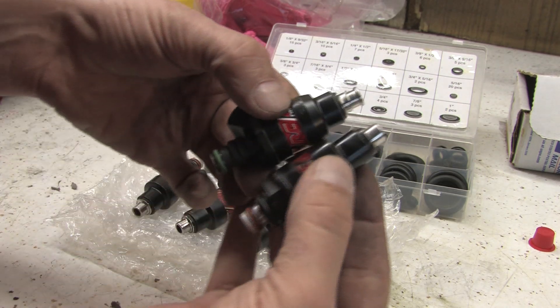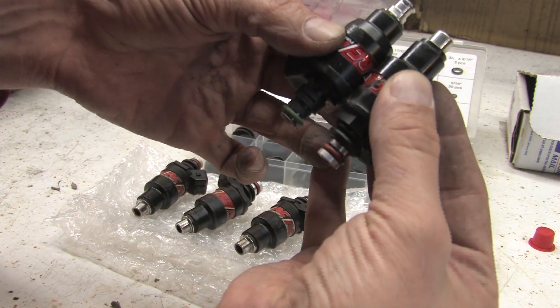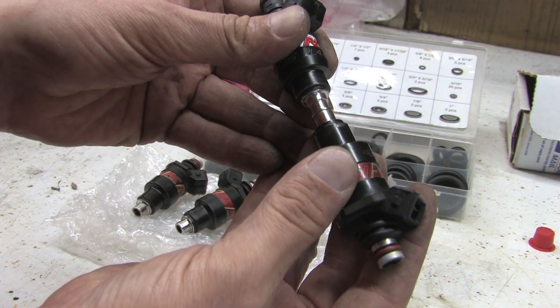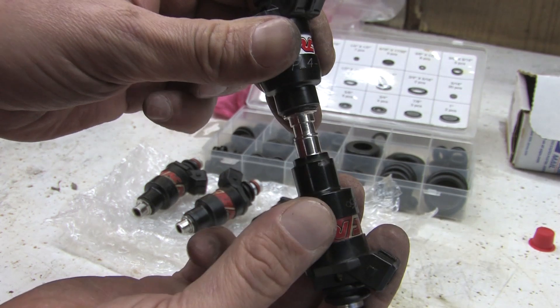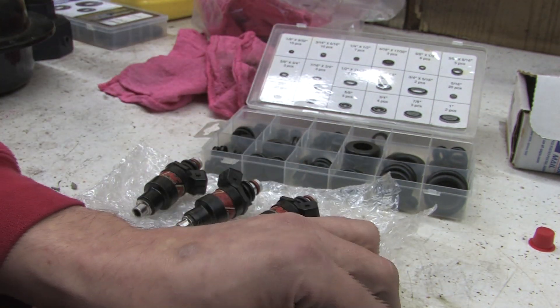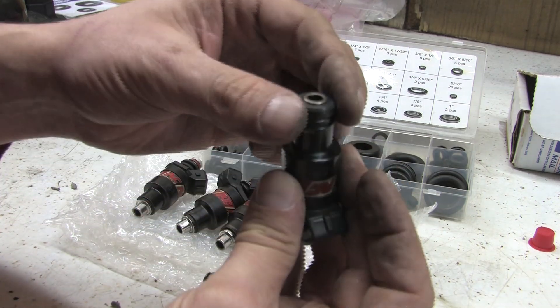The old injectors just had a straight fitting that filled up the lower seal pretty well. The new one has a slightly fatter fitting with a groove turned in it to hold the seal, but the inner diameter of the seal is bigger than that gap. I guess it's supposed to seat tighter on the top and bottom of the seal. I hope I don't have boost leak issues because I'm about to put it to the test — if I do, I'll cover that in another video.